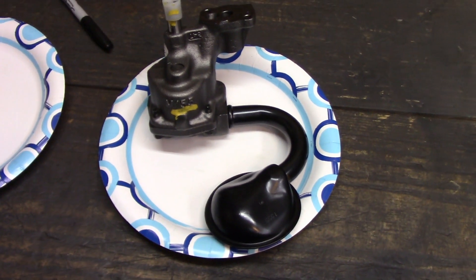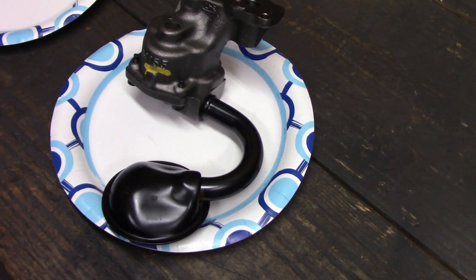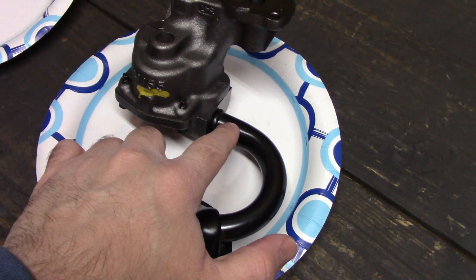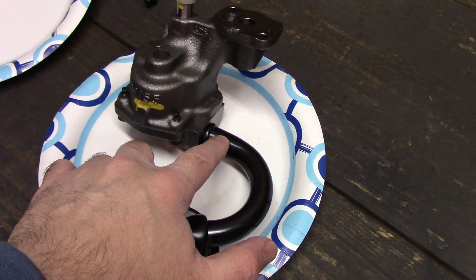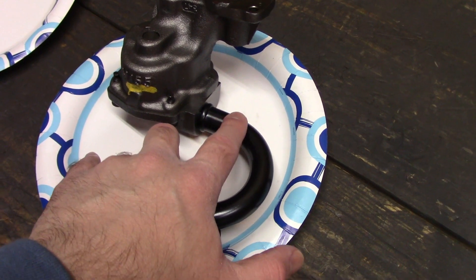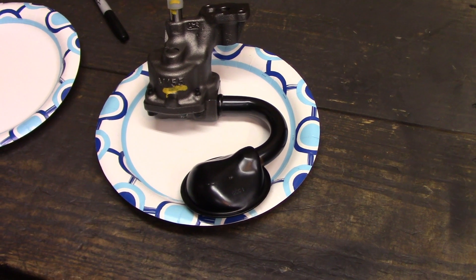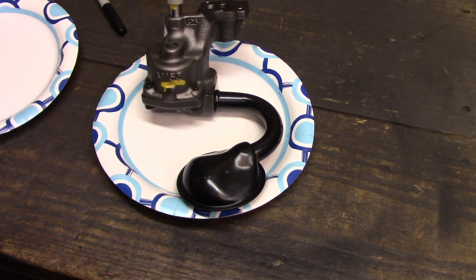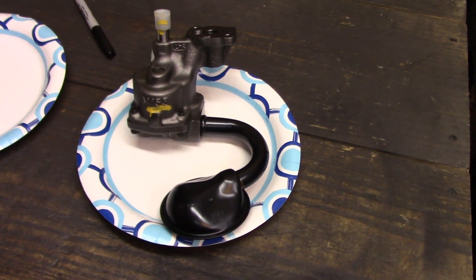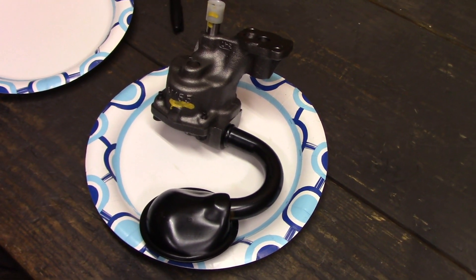Here's the M155 oil pump. They replaced the M55 because they decided to go with a larger pickup tube. The old M55 had a 5/8" tube and this M155 has a 3/4" size tube. The tube is a press fit and I'm going to have to remove it when I tear it down. Once you press fit them they're kind of loose afterwards, so I'll have to braze it if I want to reuse it. Just FYI.